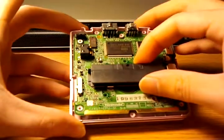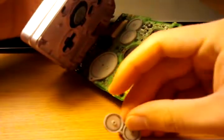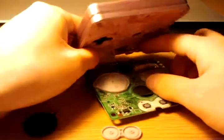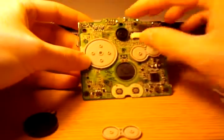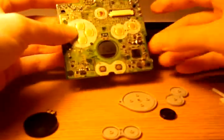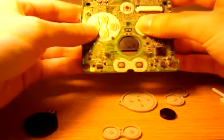Be careful — don't just pull straight out because there will be a ribbon cable in there. I lost all the buttons and the speaker, but I'm more worried about this ribbon cable. Unlock the tabs on either side and then you can slide out the screen. The construction for all the buttons is actually really simple — they're just rubber membranes, and underneath are pretty much standard mechanical surface-mount tact switches. The rubber gives a mushy feeling, but unlike an NES controller which is very mushy and rubbery, this one has a click to it as well.